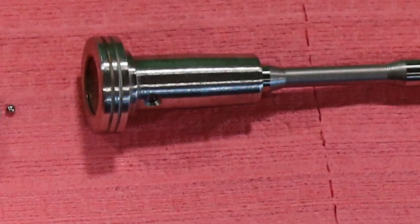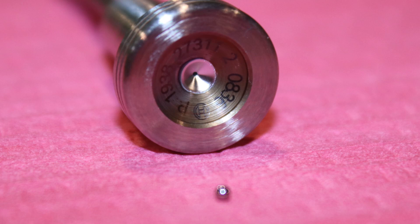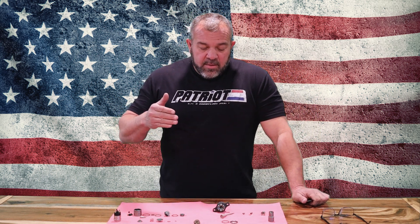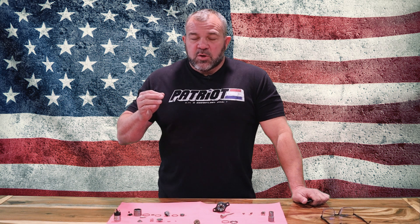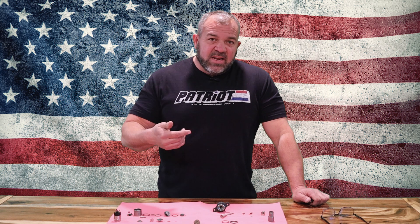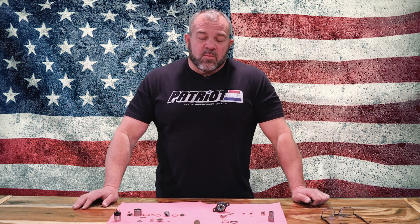There's a control valve ball right here. That little ball is not only super small but also very, very hard. It rides on the top of the control valve — right in the very top. When that ball and that seat are matched perfectly and both clean, you've got a really good, long-lasting part. The balls are extremely cheap, so we're always going to replace those. As long as that ball stays smooth and round and the seat area hasn't been contaminated, they basically will last forever — but you're always going to get a brand new one.